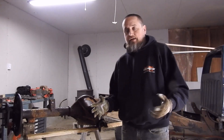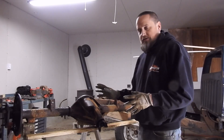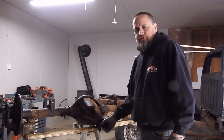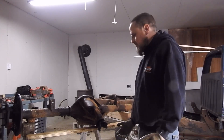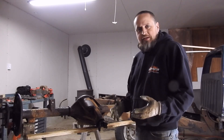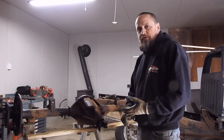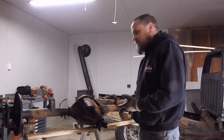So here it is the next day. I didn't get as far as I wanted to yesterday because these bolts in these axles were really giving me a hard time, probably from being up here in the northeast corner of the country — a lot of snow, salt, rust and things like that. So these bolts were in pretty tough shape. I used every form of persuasion that I owned: my impact wrench, penetrating oil, and heat.